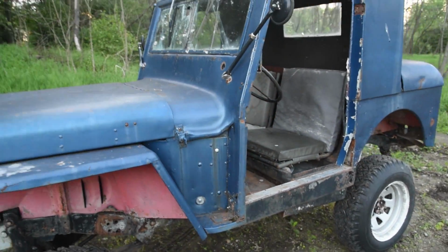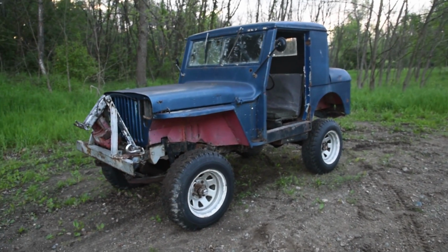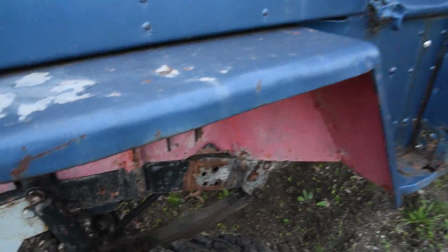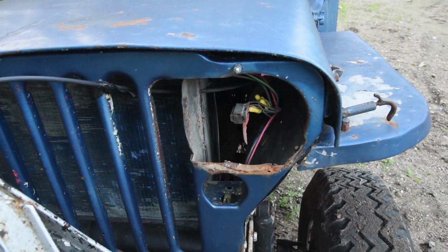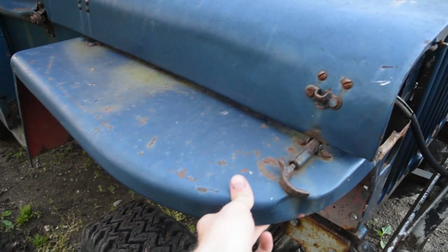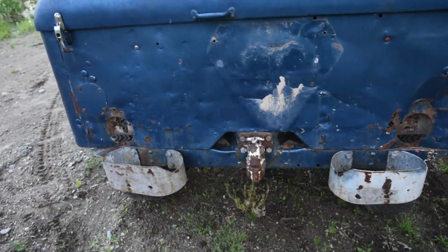But what you kind of got, if you're looking for a World War II Jeep to restore, from afar, this thing looks pretty rough, obviously, but it's got all the value of the World War II Jeep in it. You've got the original chassis, the axles, the engine, the transmission. I think these fenders are probably restorable. You can buy the little patch that goes into here. You can probably find a bent up grill to cut out this piece and re-weld this back into place. The hood is definitely usable. Same thing, this fender's usable as well. So you pretty much got the front half of the Jeep and the cowl. Personally, I think there's enough of the Jeep here, you could probably make something work without having to buy a whole new tub.